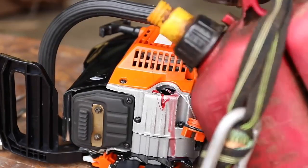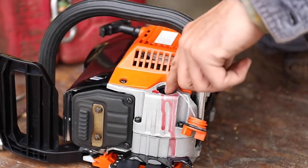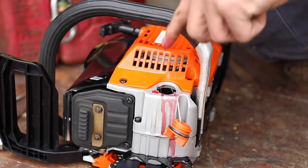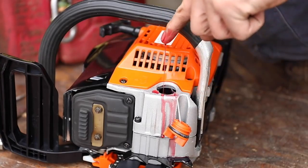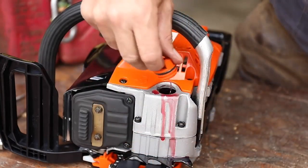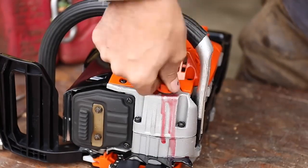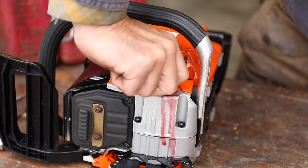You know, new oil. The problem with that is the stickiness of oil. If you take bar oil, for example, like this, look how stringy it is. See how stringy and sticky it is there? Well, that's required or recommended so that it sticks onto the bar, so it's not all flung off the end, and that it sticks and hangs out on the bar.